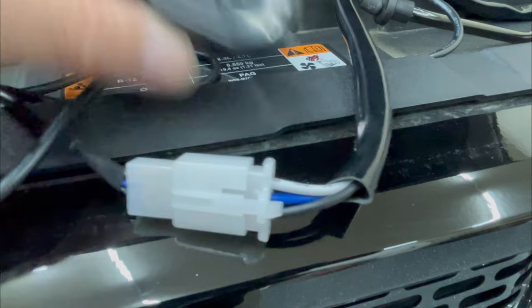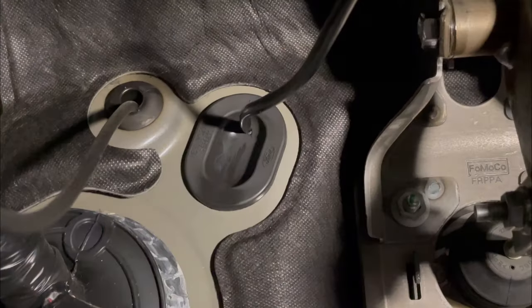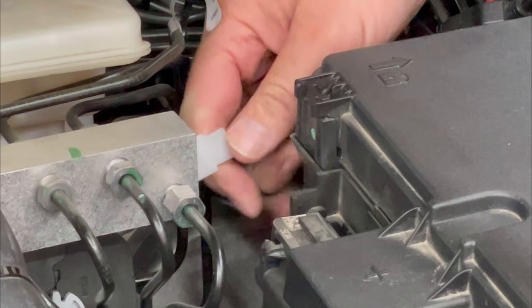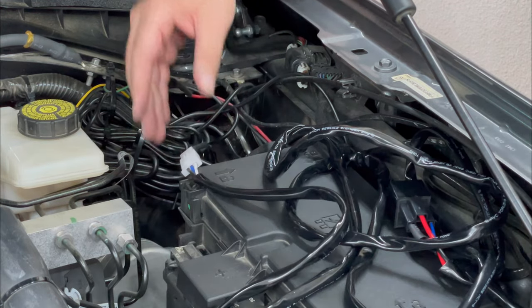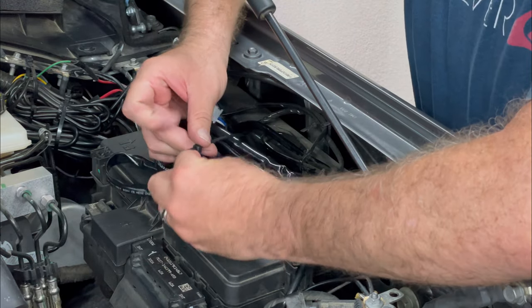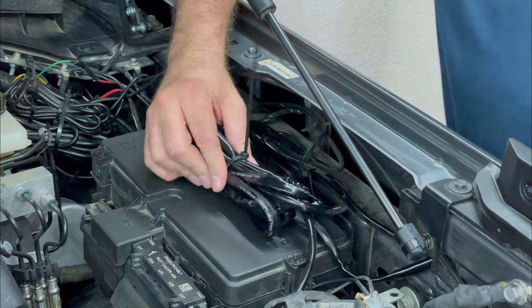To install the switch inside the cabin, disconnect the white connector. Under the dash on the driver side of the Bronco there's a grommet — pull it out and that gives you access to feed the harness through. Feed the white connector from the inside out through the hole and pull it through from the engine bay, then put the two ends of the connector back together. Zip tie all of the extra harness cable out of the way — there is a lot of it, so I bundled it and put it down beside the fuse box in the fender.